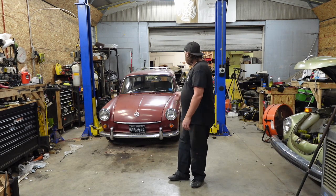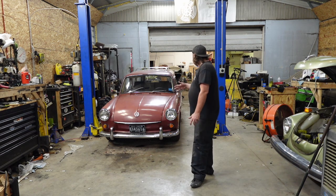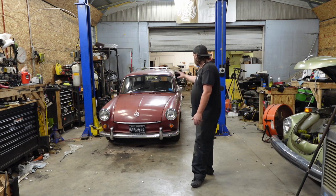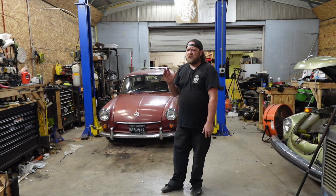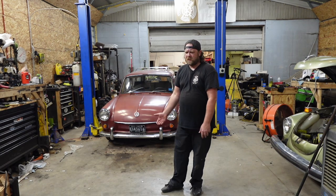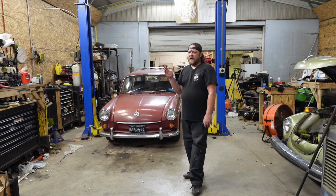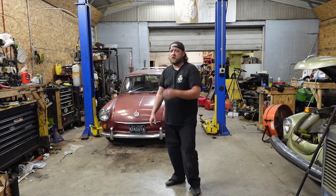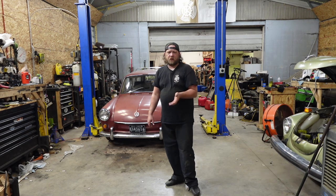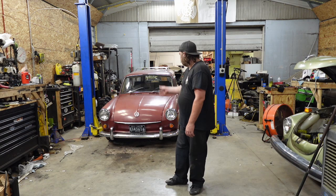So we're good there. Fuel pump relocated. That fuel pressure regulator, I'm happy it's gone. It doesn't need it. So fuel pump's done. Rear brakes holding. Master cylinder's working. Like I said, I did adjust timing. It was reading way advanced, and I don't know why. Distributor was tight when I checked it, but it's, I don't know, fine. The engine's so quiet that I thought, sorry, I had to burp, I thought it was idling way low. Now it's right at 900, which is perfect. It's a generator engine, so you need a little extra chooch. So it charges, it stops, it pumps fuel, it's done.